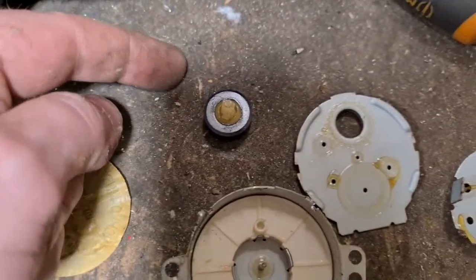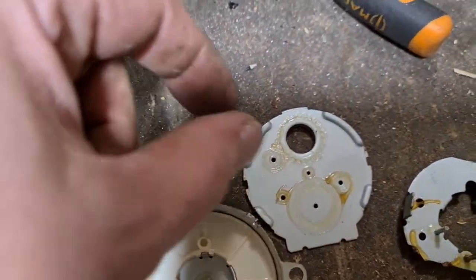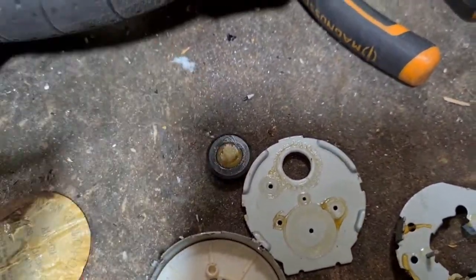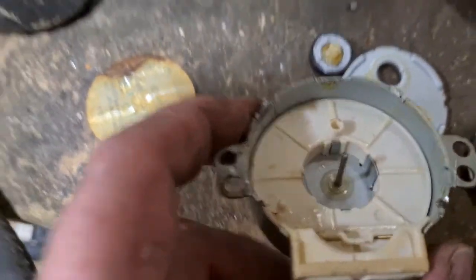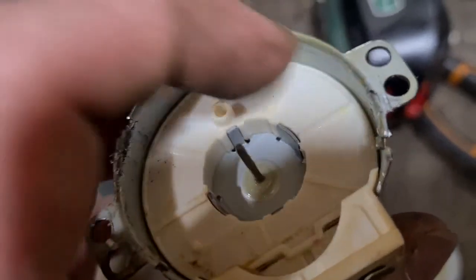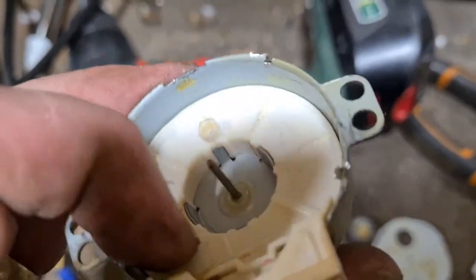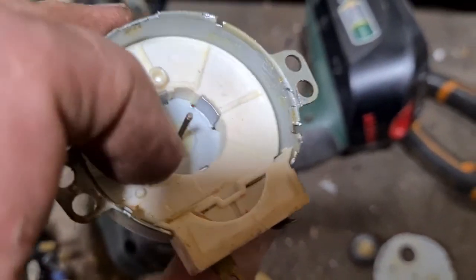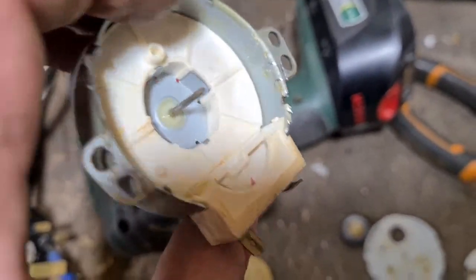and we've removed a little piece of ferrite in the middle. As you get in most motors, there's always a little magnet piece in there, a little ferrite magnet, and that leaves us with this piece. As you can see, we've got the brass connectors, and we've got a sealed plastic area inside, and it's inside this sealed plastic area that we get the copper, so that copper's all sitting inside there. So let's get it out.